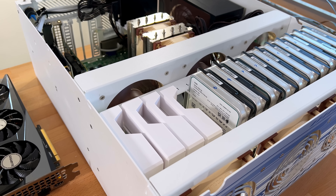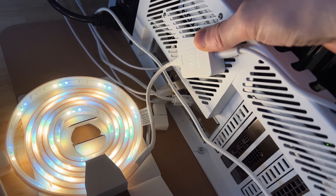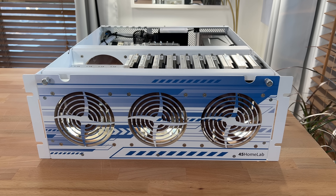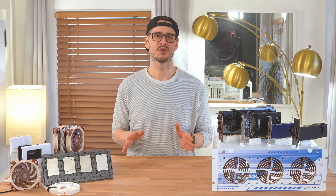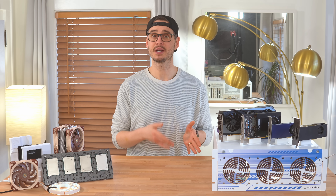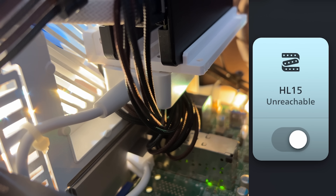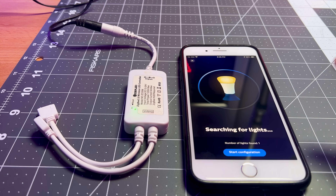I also added four Samsung consumer SSDs using 3D-printed 2.5-to-3.5-inch caddies so they could mount into the server backplane — those six caddies alone pushed me over the edge to finally buy a 3D printer. These SSDs will likely be used for Docker volumes, VMs, or LXC containers down the road, especially if the main pool gets too busy. And yeah, I added RGB — but it's not just for looks. I used a Hue light strip, cut it to size, and rounded it to the chassis. It's Zigbee-based so I can control it with Home Assistant, trigger it on motion in the server room, or even change the color based on temperatures. Only issue: once I mounted the Zigbee controller inside the chassis I lost all connectivity — probably RF interference from the motherboard or PSU.